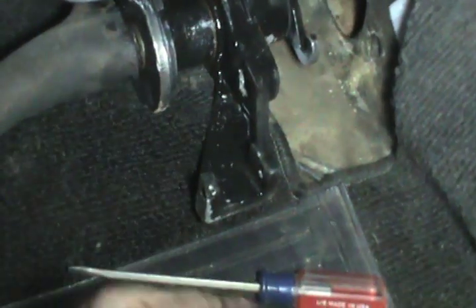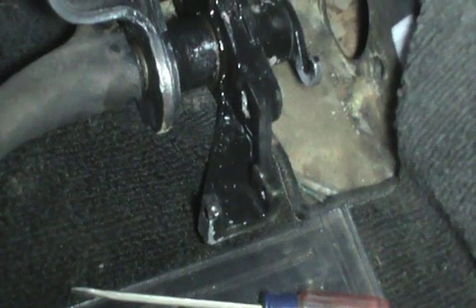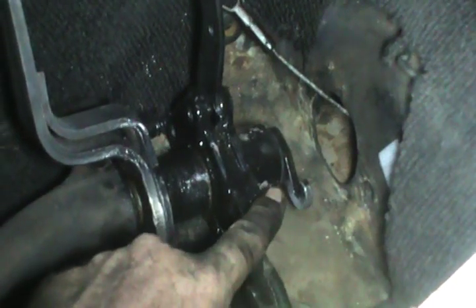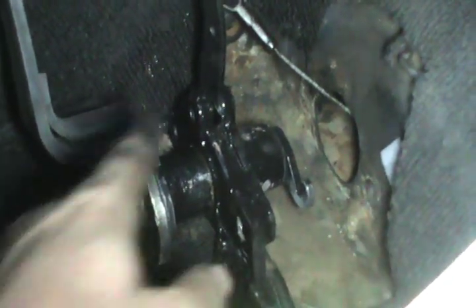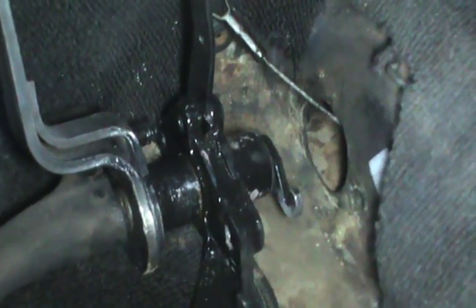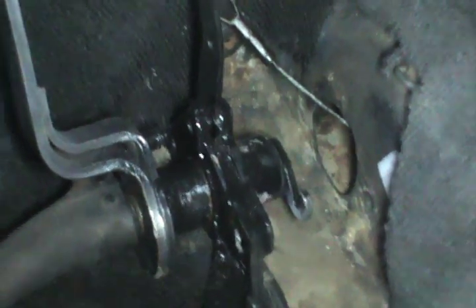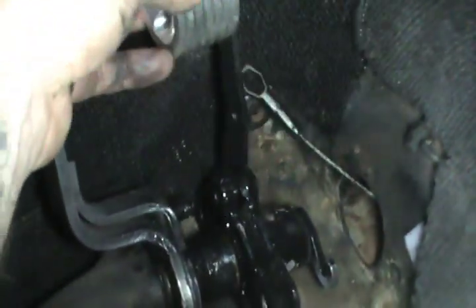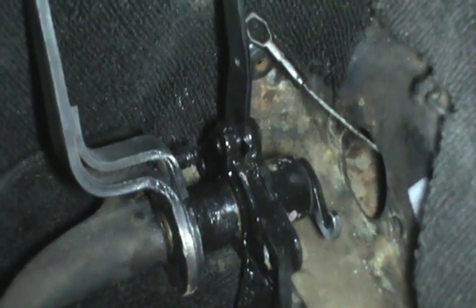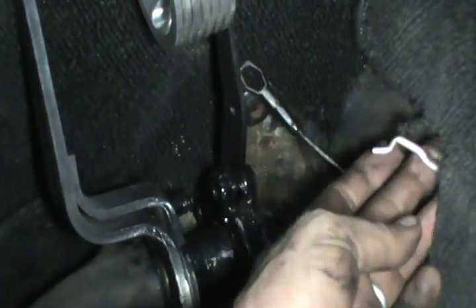This isn't routine maintenance, but with a car this old — especially a Volkswagen — you need to keep up on stuff like this. We had all this full of crud, the throttle was hanging up, it was broken off. Got the assembly off, cleaned it all up. We got our oxidation problem under control — just a little bit of primer and some paint. I'm gonna go ahead and hook the eyelet on here, get my push rod for the brakes going to the master cylinder — it's working real free.